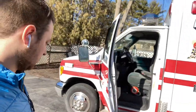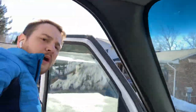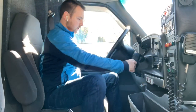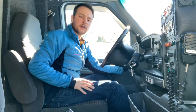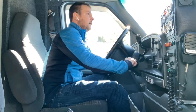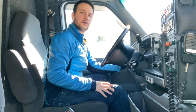Here's a quick demo of the startup sequence and electronics. We've got a master power switch here — turn this to the on position as it kills power to absolutely everything. Keys in as normal; you actually have to press and hold the engine start button for about 15 seconds. This is heating up the glow plugs for a diesel engine. After about 15 seconds it should be good — and there she goes.